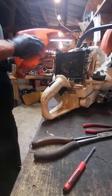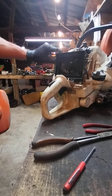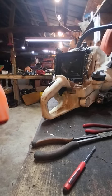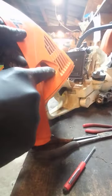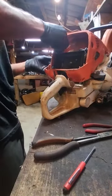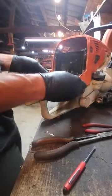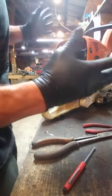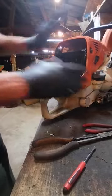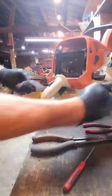There is a trick — you want this choke sideways, you want it open when you put the cover on, because there is a notch. See how it's longer one way than the other? That's how you've got to put the cover back on. Don't force it — if you force it you will break stuff. Make sure all the holes line up. See how it just kind of popped down in there? I can feel that's exactly where it needs to be. Always start on the top and sock that down.